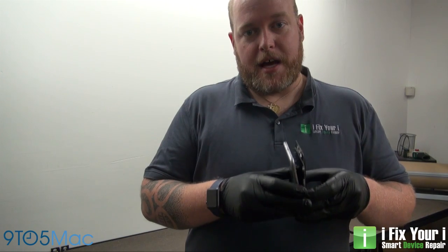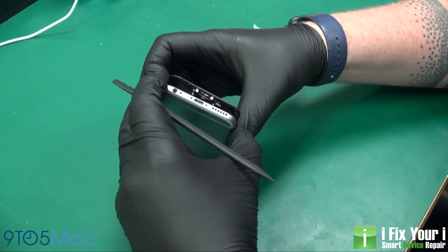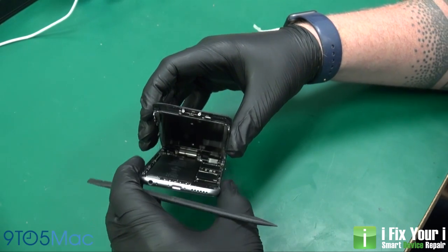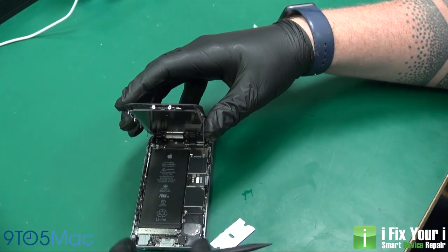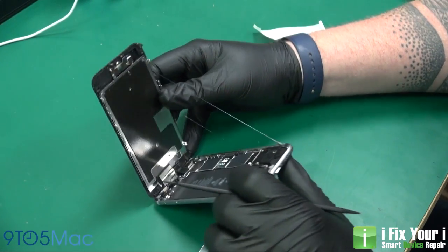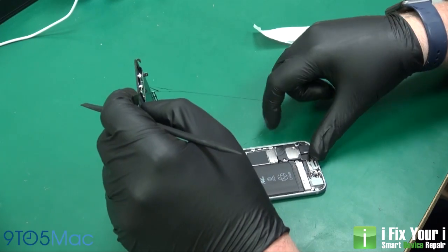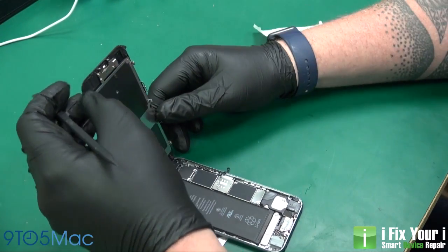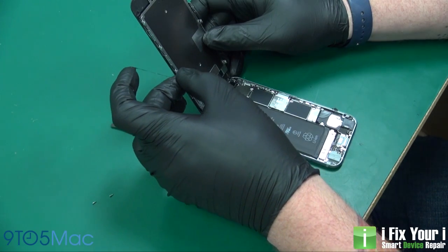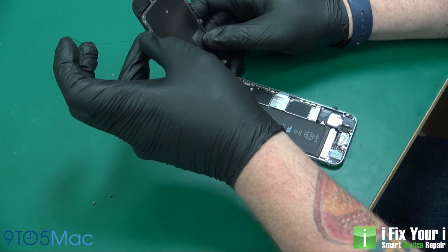What we see with the iPhone 6S and the 6S Plus is that they've actually sealed the entire frame of the glass and LCD to the back housing. So it's not just held in with clips at the top and the screws at the bottom, it's sealed completely. So the only entry points for water now are through the charging port, the mic, and the headphone jack, and on the top, the ear speaker, the vibrate switch and the volume switches, and the mic on the back.